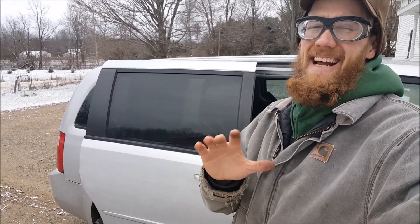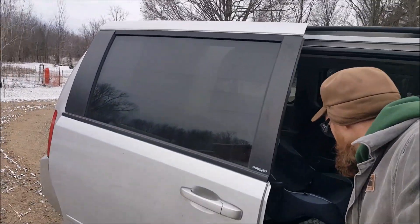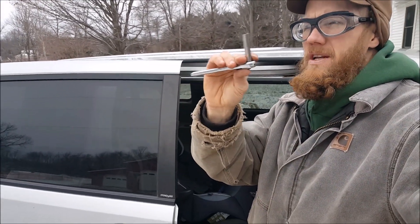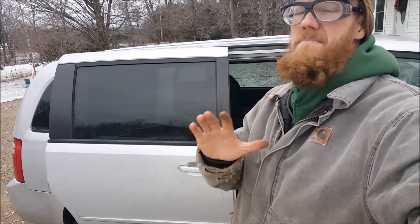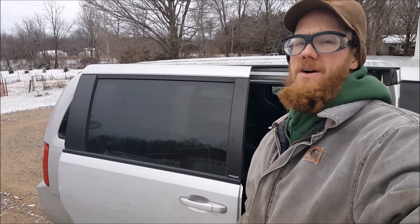I just got done with my hand inside the door body. The biggest thing I can tell you is it's an eight millimeter fastener — eight millimeter socket. I found it useful to use both a deeper well and a short one. Once you get tightened down, the mechanism gets in your way and you need the short one to really snug it up. When putting the cables on, if it were warm it'd be easier. If you drop anything down in there, it's gone.